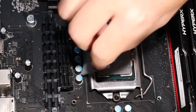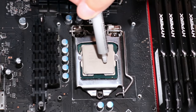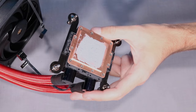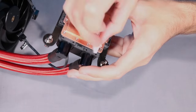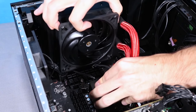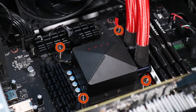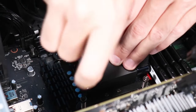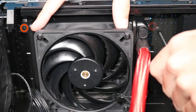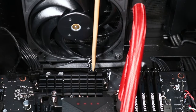Replacement: Before replacing the liquid cooling system, clean off and replace the thermal grease on the CPU. The thermal grease should be replaced every time the liquid cooling system is removed. If you are replacing the same liquid cooling system, clean the thermal grease under the pump as well. Carefully place the liquid cooling system back into position — the pump hoses should be aligned next to the memory modules. Tighten the four captive T15 Torx screws to secure the pump over the CPU. Replace the two P1 Phillips-head screws securing the fan to the top of the unit. Reattach the fan and pump connectors to the motherboard.